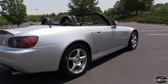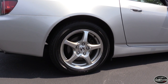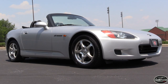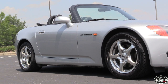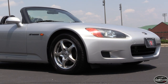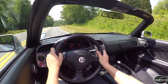It was designed from the get-go to be a roadster, but one that offered impressive handling and a stiff but lightweight platform. The level of rigidity this car has is very comparable to a fixed-roof car. That's no small task for convertibles, often requiring additional bracing, which can lead to an unfortunate increase in weight that could compromise a variety of performance factors. Luckily, this was not the case for the S2000, thanks to a new monocoque body and centralized backbone frame that was designed specifically for this application.